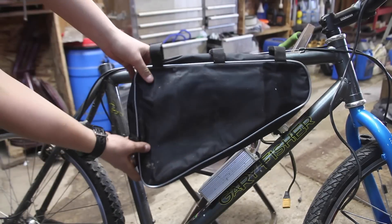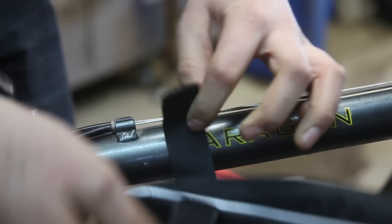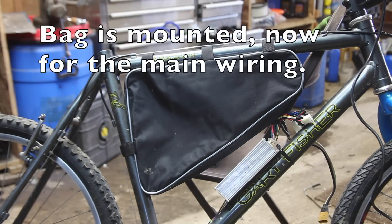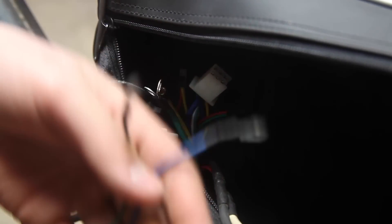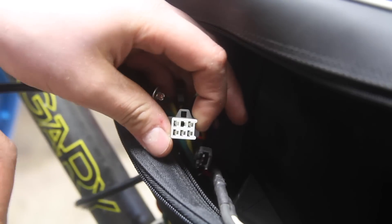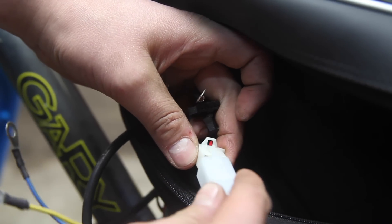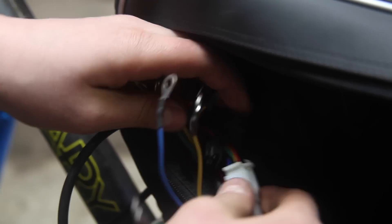Now I'll put the battery bag on the frame under these little pieces — it's Velcro and we just tie it on. The motor wires go in the bag. Right here are the three main leads that go to the motor, and then there's another little connector that has five pins. If you look at the connections to the ESC, there's a little white block with six holes but only five have wires — this just plugs in with the pin going into the hole and it clicks right into place. That's all you do for that one.